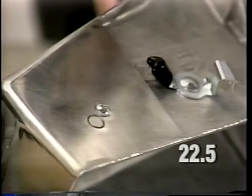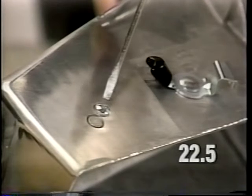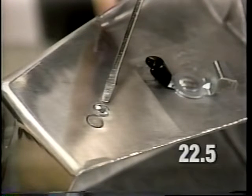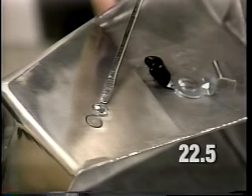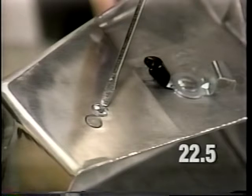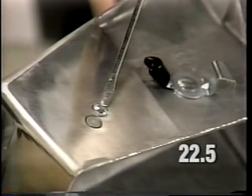If the BPI light is defective and requires replacement, remove the nozzle bumper. Then remove this screw. Remove the BPI light from the nozzle casting. When replacing a BPI light, use the correct light for the correct model. Generation 3 and G4 BPI lights are different in their construction.